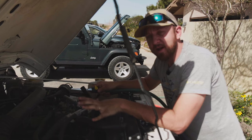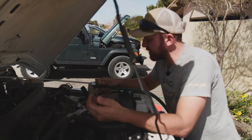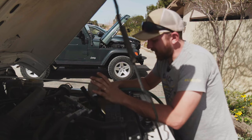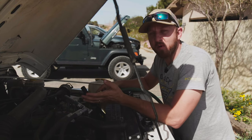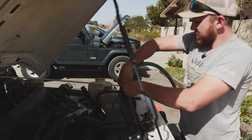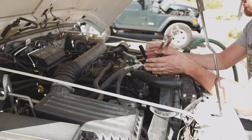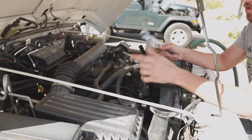We've got most of the coolant out of the system — at least everything that could drain on its own. I replaced the buckets so there's a completely empty one underneath. I'm going to start putting water through here and letting it flow through the system. I want to get all the coolant out entirely, which means putting water in a few different spots while capturing it all. Once all the coolant is out, we can flush with water and just let it go on the ground. Next step is getting the coolant out of the heater core.